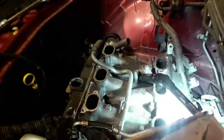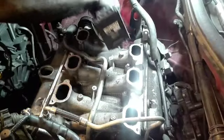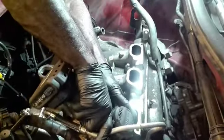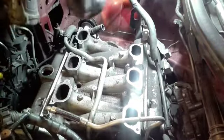Damn it, boy. So how am I getting to this other one down here comfortably? I use a 10 millimeter ratchet wrench and it's working out perfectly fine. I have to use a 10 swivel on that side, and then on this corner I'm using this 10 ratchet. So I finally got the end bolts out. Let's zap these out. I'm going to leave the thermostat in there. Take the thermostat housing out together with the outlet. Damn it.